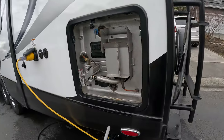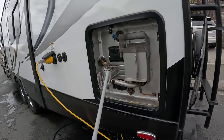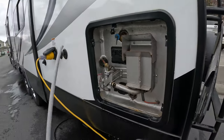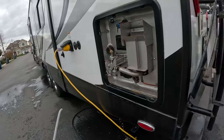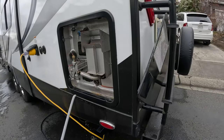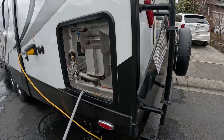So we're going to let this drain. I'm going to grab our anode rod. We're going to re-thread it with tape. I'm going to reinsert it back in here. We're going to hook this back up to city water. And then we're going to flip the bypass to the normal position and then fill the hot water heater.